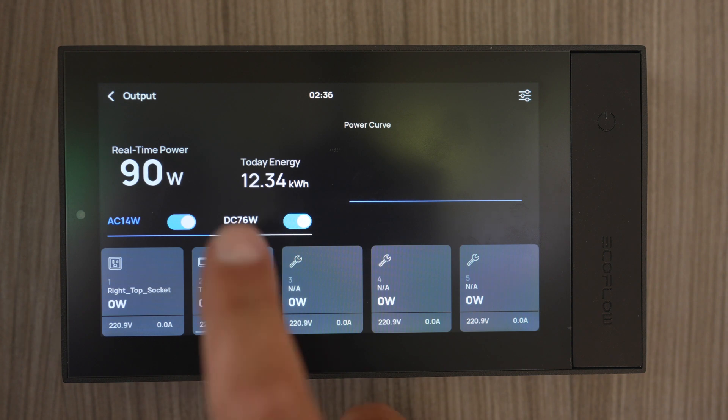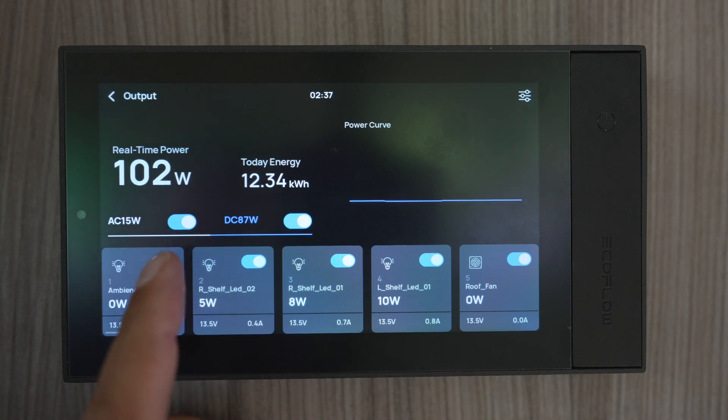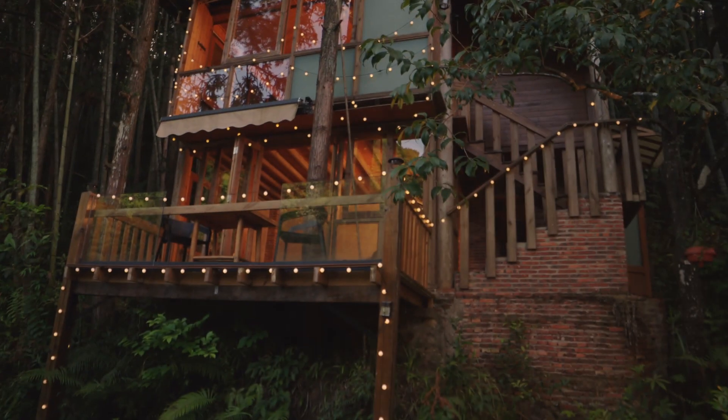Six of the 12 DC circuits — circuits one through six — can be remotely switched from the mobile phone app or the 7-inch touchscreen. For example, say you had a series of outside lights around your van and it's late at night and you hear a noise outside — you can just pick up your phone, click a circuit on, and put on all the outside lights. You could also use it for controlling lots of other circuits within the vehicle, such as your water pump, that you'd like to be able to switch from the control panel.